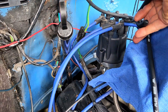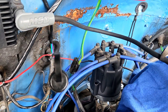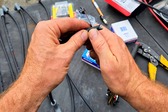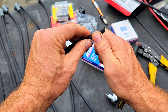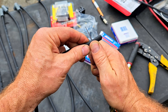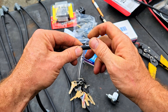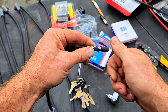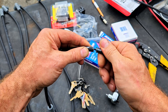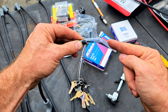We're gonna cut it right here — I'll give myself just a little more room than I need. When pulling the insulation off to get to the spiral wire — that's what these are called — I like to use a knife and just barely score it all the way around. Don't push too much, just get through the black section of the wire, then twist slowly the way the wire is fed, since this is spiral core. When you get to the end you'll see it come right out.